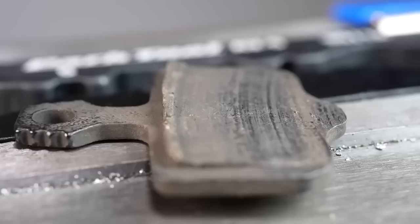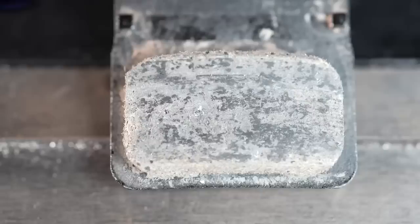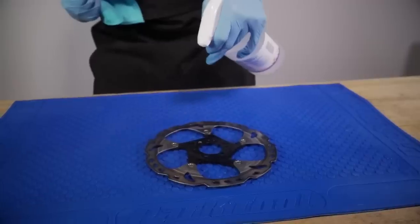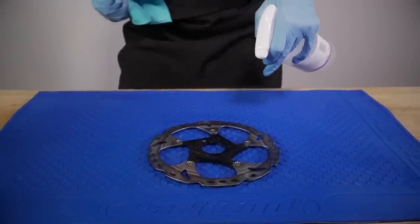If there's a lot of rust coming through onto the pad itself — if you touch them and there's a lot of orange on your hands — that might reduce your braking performance altogether. Like a car left in the rain for a week, the brakes rust easily and won't feel great. The same happens with mountain bike pads, especially steel-backed ones. I would say clean them up with a wire brush and some isopropyl alcohol, get that surface rust off, then bed them in again.